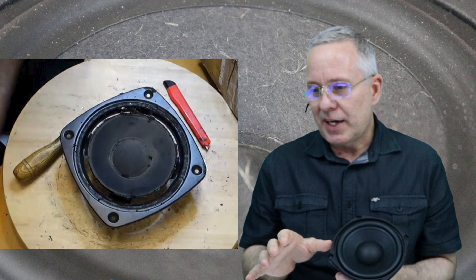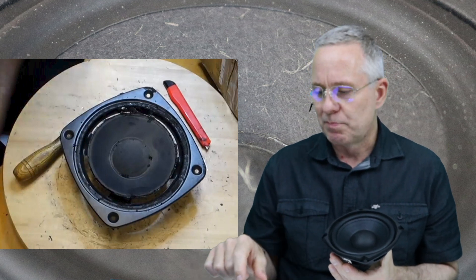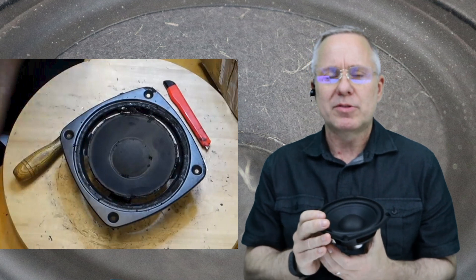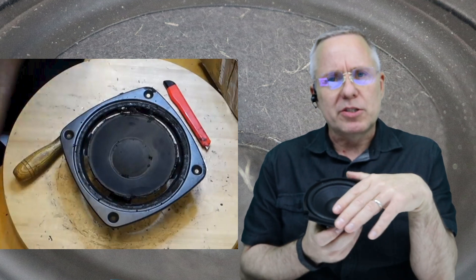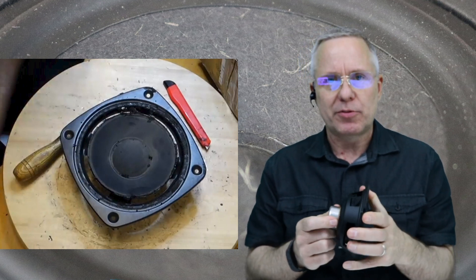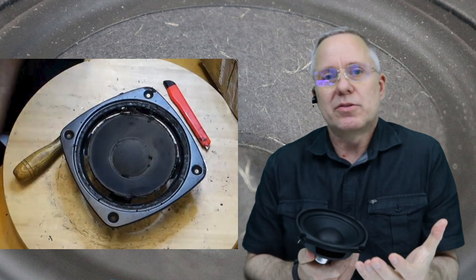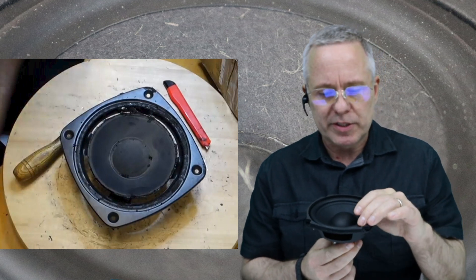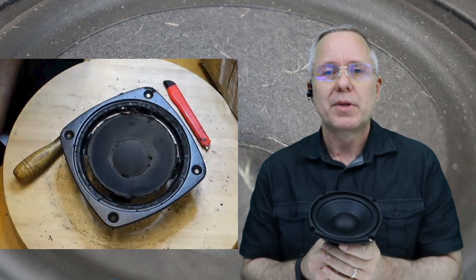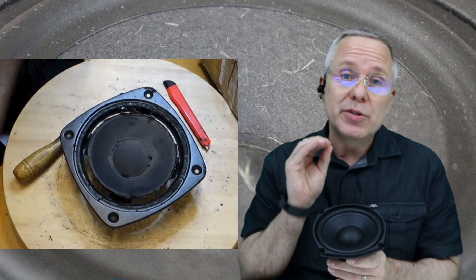I did a video in Danish many many years ago, so let's go through the process of replacing one of these edges. I want to talk a little about some of the stuff in general, because there's no standard to the size of speaker driver chassis. You do hear about five inches, six inches, eight inches and so forth, which could sound like there is some kind of standard, but there really isn't. The measurements are far more precise, and for this to work like it's supposed to, you really should try and find online the specific foam edge for your model of speaker driver.